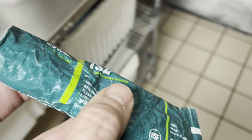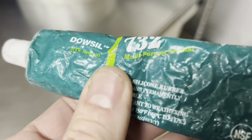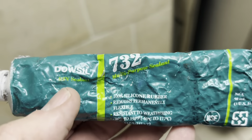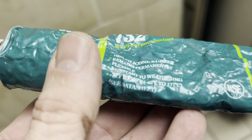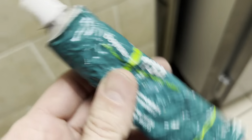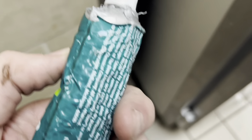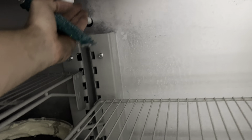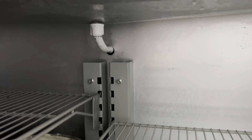This is a well-loved tube, but this is what we use in the ice cream machines for sealing up inside the barrels because it has to handle 10 below. You can see this silicone is actually good to negative 70 degrees Fahrenheit, so this is what we're going to use to remount this bracket. I'm going to put a pan underneath it to hold it up and apply upward pressure on it until it's cured.